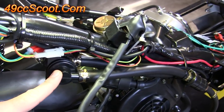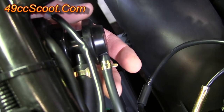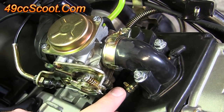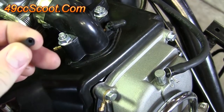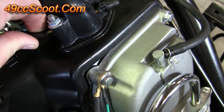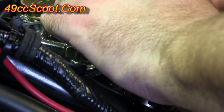To start off, you'll need to locate this canister on your frame. You should see that it's got two large hoses, and on the other side, one small vacuum hose. Trace that vacuum hose — you'll find it goes to your intake. Go ahead and pull that hose off of the intake. You'll need to install a vacuum cap like this one; this is an eighth inch. It should just slide over the port. Then you can use either a wire tie or a hose clamp to make sure it stays in place.